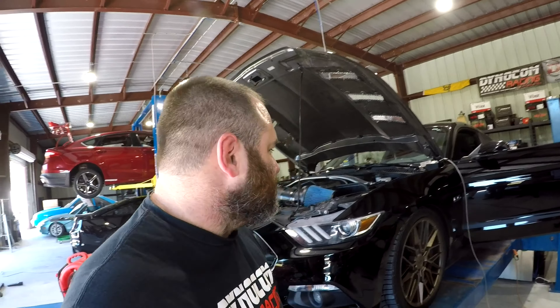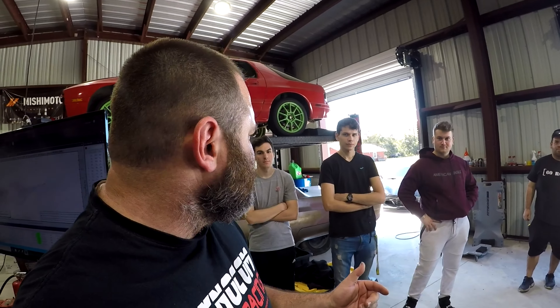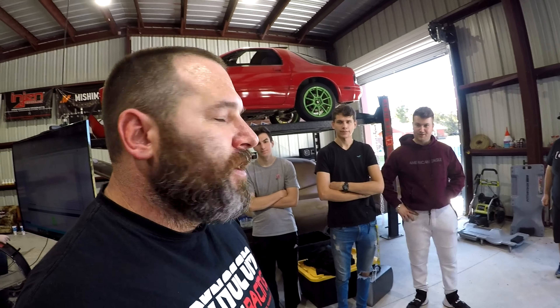We're using an N gauge and HP Tuners to tune it on HP Tuners. This car is running with a PMAS cold air intake, our Mafia ported 2018 upper intake, and long tube headers — Catalyst long tubes — with 47 pound injectors. We're on 93 octane, but eventually they're going to upgrade to E85 and make some real power.